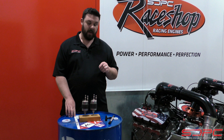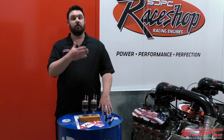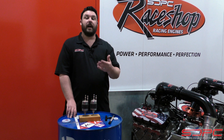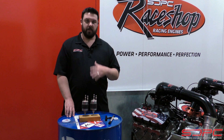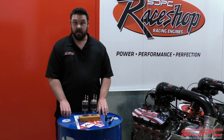While that'll work for a 4.8 all the way up to our LS7s, we do need to make a note that this isn't for the supercharged or turbocharged guys. For that, you need a boost reference fuel pressure regulator. We do offer those — feel free to give us a call. We'll definitely get you set up with all the parts that you need. But today, the naturally aspirated guys are going to get our attention.